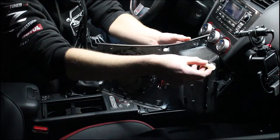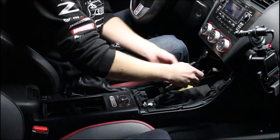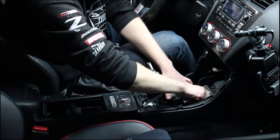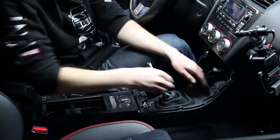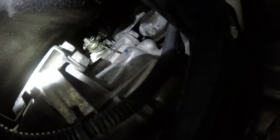This connected piece is going to be pressed in here — push in the pins from this side and pop it out, then move the wire in the clips. Next, you're going to cut the zip tie that's holding in the reverse cable. Remove these two plastic screws. This is the end of the reverse cable — push it and then stick an Allen key in the hole to hold it in place, which makes it a lot easier to get the shifter in up top. It's kind of an important step.